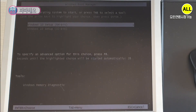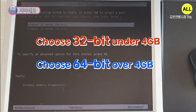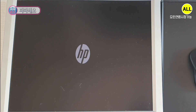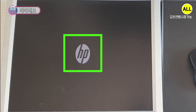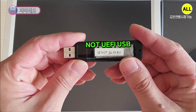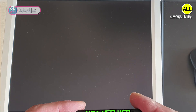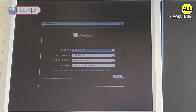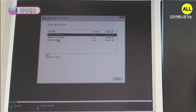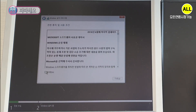Everyone knows how to install Windows 10, but I will explain it in detail again. Since I have more than 4GB of memory, I will select 64-bit to continue the installation. When installing Windows 10 for the first time, if the manufacturer logo appears, it is installing in UEFI mode. One interesting thing to note is that the current USB installation disk is not a UEFI disk. The installation start screen is displayed — click Next, then Install Now. I don't have a product key. Select the version of Windows 10 to install and click Next. After checking, agree to the terms and click Next. Custom selection.